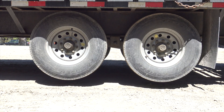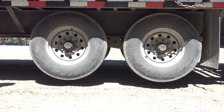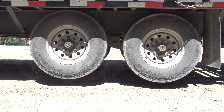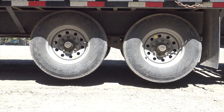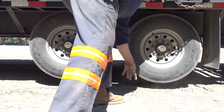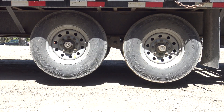We installed the new connectors. Raymond's going to yank the chain when I tell him to. Brake - there we go, that's the way it's supposed to work! Plug it back in, Raymond. That was the noise you should hear when the brakes release. We're going to try that one more time with the rear wheel brakes - that's exactly what you want your rear wheels to do when the breakaway pin is pulled.